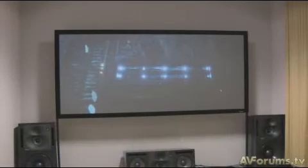The biggest problem in development was matching the performance of the projector. One of the major challenges is that this JVC projector has a huge vertical off-axis capability — you can shift the lens really far up. Most anamorphic solutions require the projector to be in an on-axis position, centered on the image. In this solution I found a way where you can shift the image to the maximum vertical off-axis position and still achieve very good image quality at a 2.35:1 aspect ratio — that is the biggest challenge in making anamorphic systems.